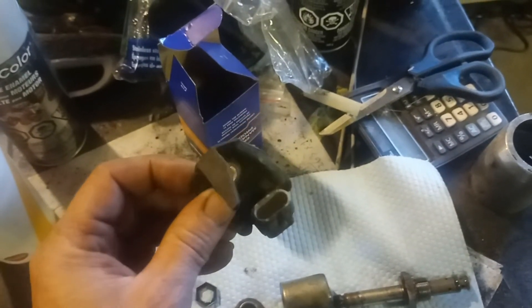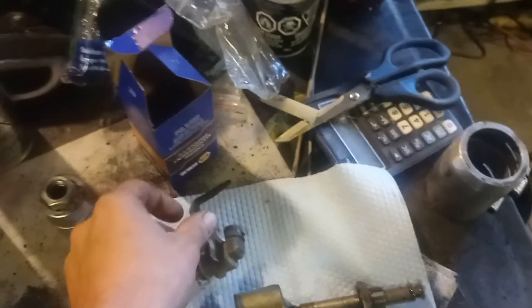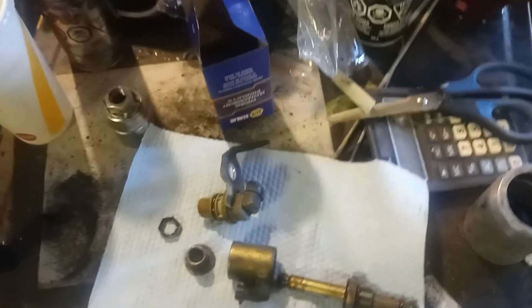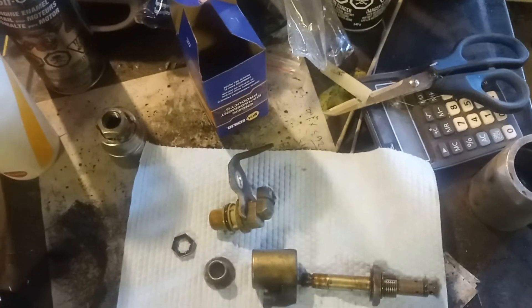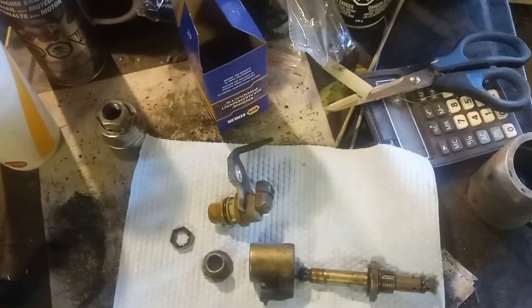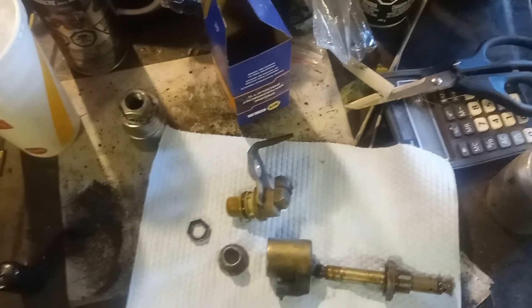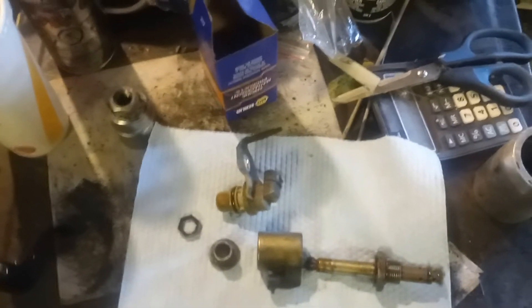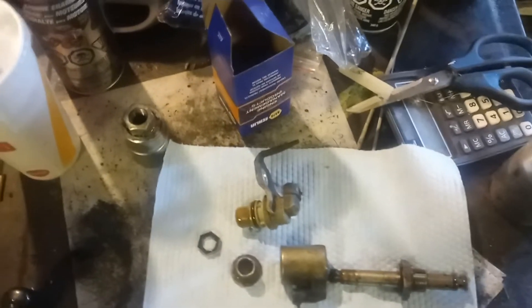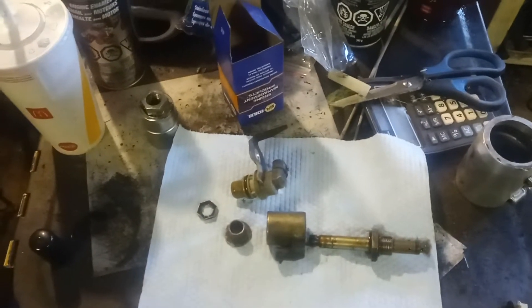Usually the symptoms are it'll just keep dying — it would all the time start then die out. There's another sensor I don't have to show you, but it's called the injection oil pressure sensor, and it's on the driver's side kind of by the valley near the high pressure oil pump.